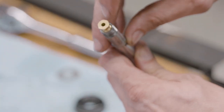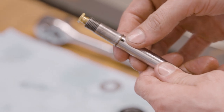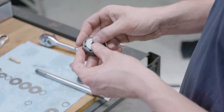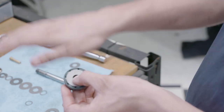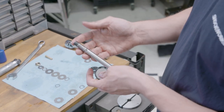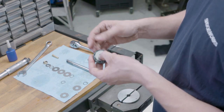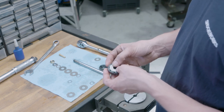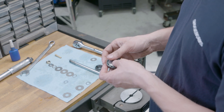The oil travels through here, and you can see the adjustment tip inside with two ports where the oil relieves through. Because we have such a reactive piston with preload on the disc, it can tend to copy the road - over small inputs the wheel won't release and you'll get the body copying the road. By having an oil bypass bleed like this, even though it seems simple, it's the easiest way to relieve oil pressure past the piston. Instead of a reactive car, we can relax it, have a car that breathes down the road, and then have an adjustment system where once you wind it up it becomes very reactive. At Phillip Island or Sydney Motorsport Park you can have a much higher-responding damper and keep the body sucked into the road.